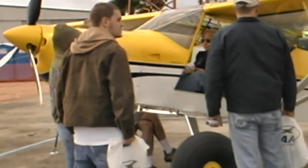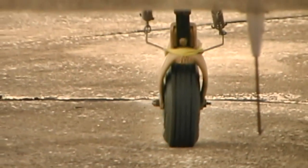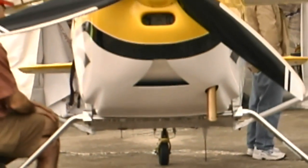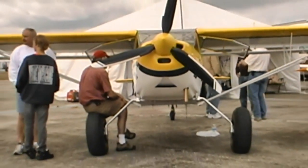However, that was with the same pitch of prop, meaning higher RPMs because it was flat. So we coarsened up the pitch of the prop by about half a degree — taking a heavier bite because we now had the torque to do it. Our climb almost stayed the same but we gained in speed — almost five miles per hour. And keep in mind, I'm a little out of my element down here in Florida. When I get back home to Idaho, I'll have a better idea of exactly what to expect in the high country.